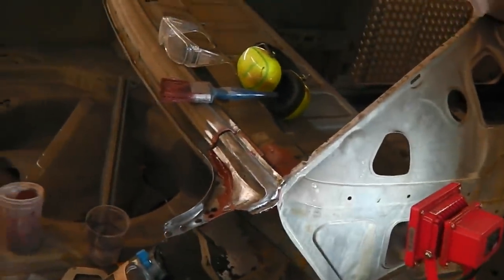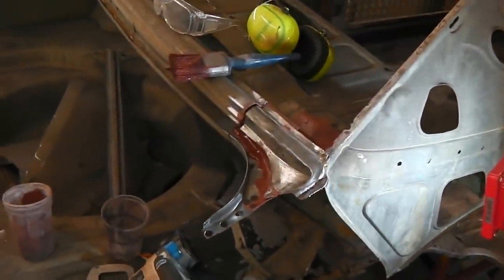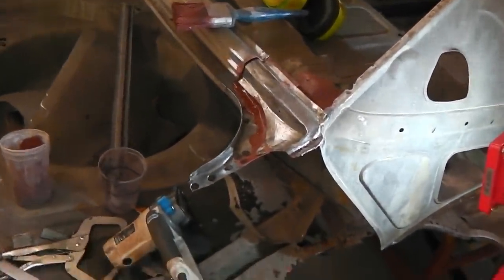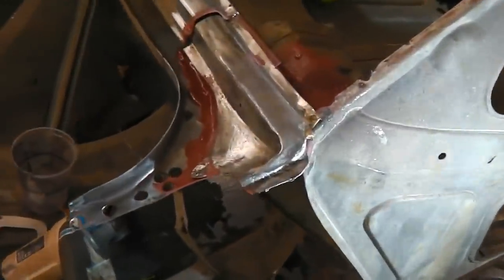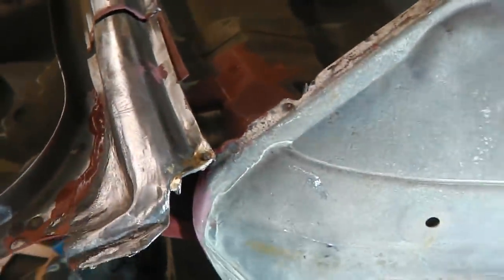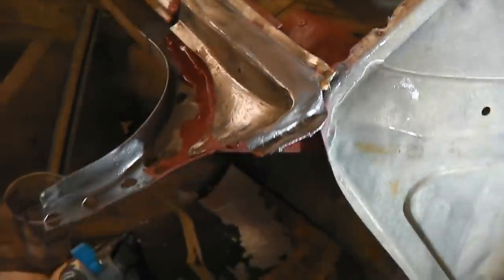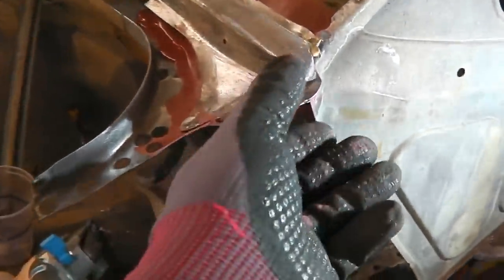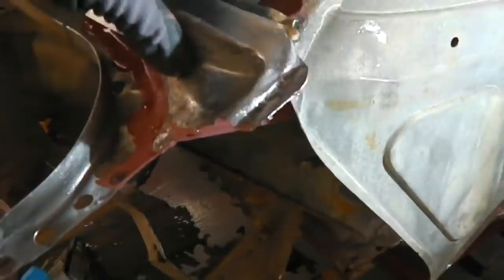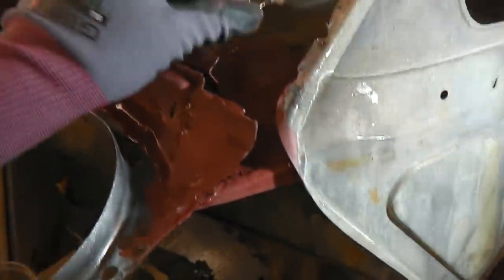Stepping back, you can get a better view of where we actually are on the car. You can see top right hand corner where the boot lid fits. Rain gutter channel, aeroflow system, all combined. Back window seal, the whole lot. Intersection with a quarter. So a little tricky, not a hard repair, but if you've got that panel, you're halfway there. Luckily that was a good one that we've kept. Okay, off I go.